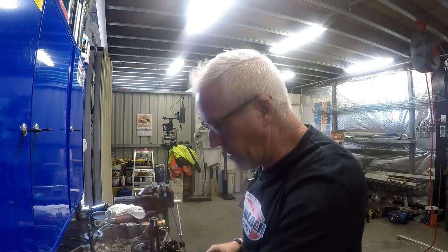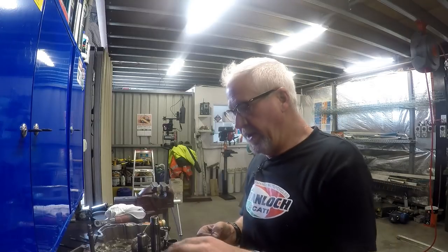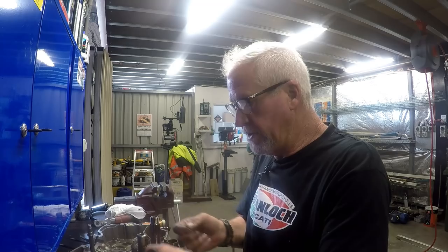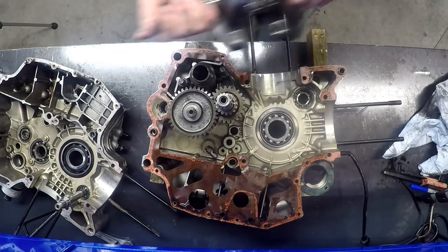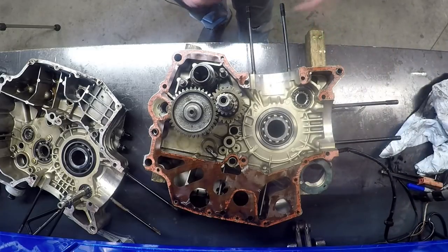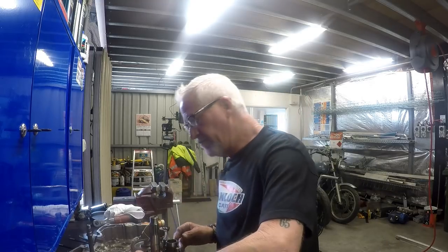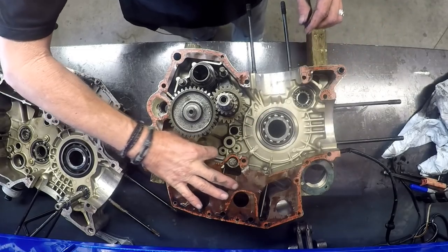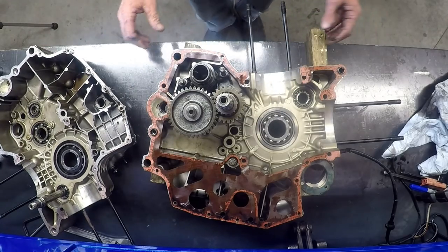I just had to sort out a big oily mess. A couple of things — I've found the shim on the clutch side is broken through, it's in two pieces. The shim on the other side is okay. We'll put all new shell bearings in while we're in here, we'll just replace all the bearings. The oil pressure relief valve also popped out as we separated. I hadn't drained that sump very well and there was oil everywhere.